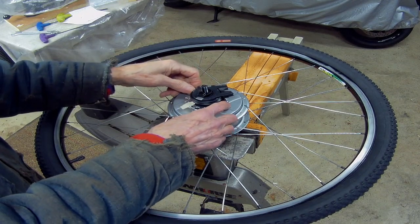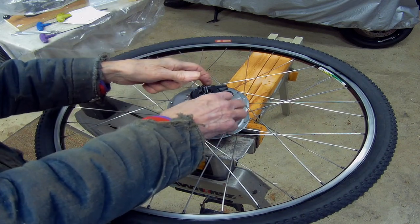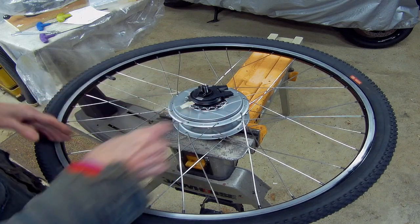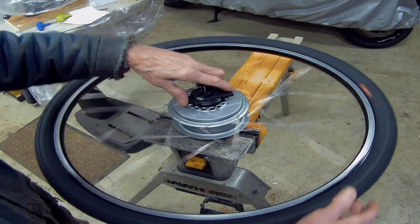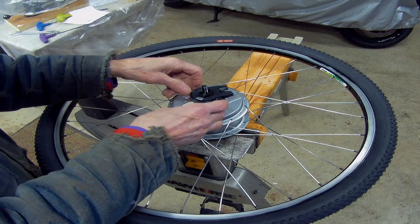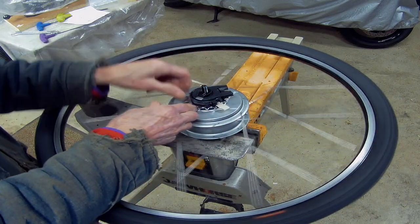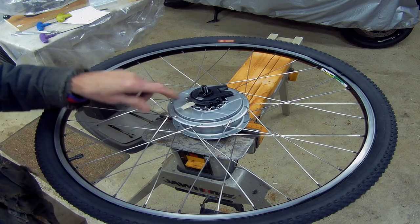Yeah. And I've got a piece of tape that I'm using to match up with the valve stem. So I've got it set on underdrive, and so we got one full revolution, and it's over there. 2 full revolutions, and it's over there. So it's 2 to 1 and a quarter or whatever. Get this recalcitrant gear set over. Okay, let's go back here and we'll line up. It's a higher gear. I got 1 here, I'm still over there. So 1 to 2, 2 times for 1 of this in the overdrive.